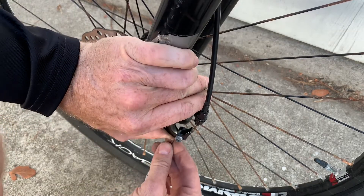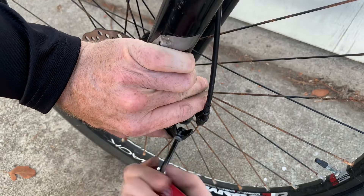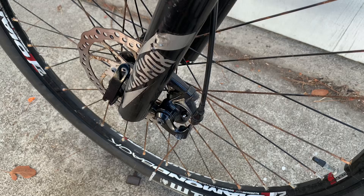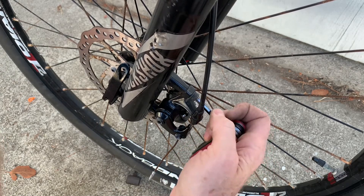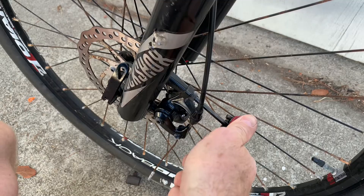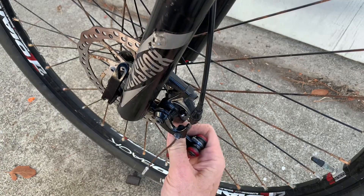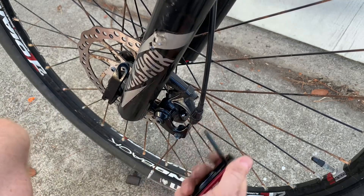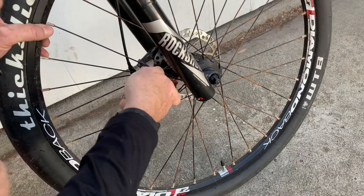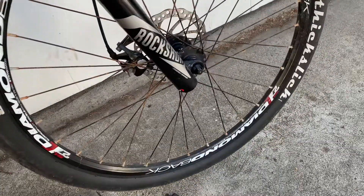Now I'm going to adjust the cable — I'm going to leave a little bit of slack in it and then tighten it on here. To get the brake pads centered on the disc, I just pull the brake lever and that centers it, and then while I'm holding the brake lever tight I crunch these down and that will center the brake pads. The back brake pad can't move — it's a solidly fixed one and the outside one towards me is the only one that can move. After we get these tight, from the back I'm just going to screw this pad adjuster out again so the wheel will turn and the brakes will stop it.